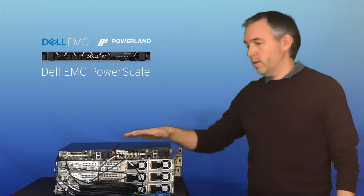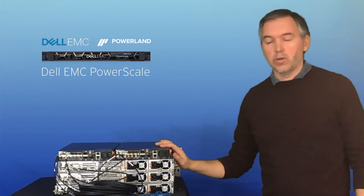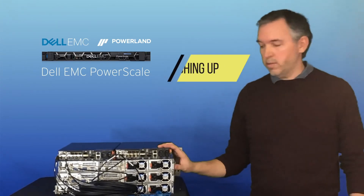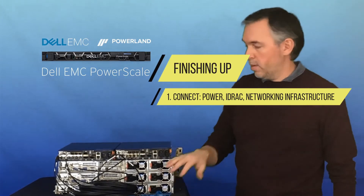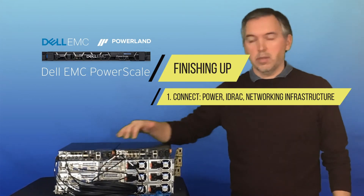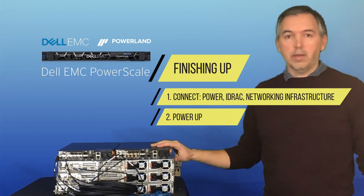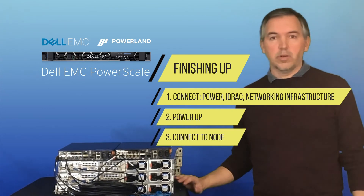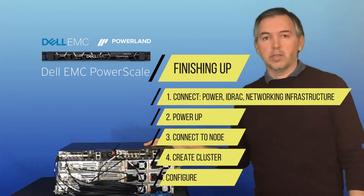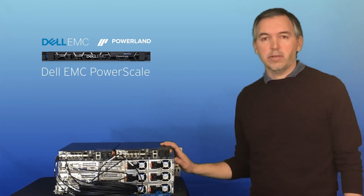Often the nodes will be at the bottom of the rack, switches higher up or at the top of the rack. You can continue to expand your nodes by continuing connections into these switches. All that's left at this point is to connect power to everything, connect your iDRAC into your network, and connect your networking infrastructure into these ports on the nodes. Then you power up everything, and when you connect to the first node you'll be presented with a menu, one of which is to create a new cluster, and from there you start to configure your new PowerScale solution. Hopefully this gives you a good idea of what it looks like and how it goes together. Thanks for watching.